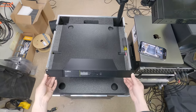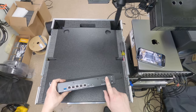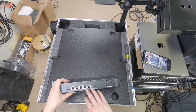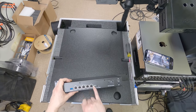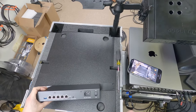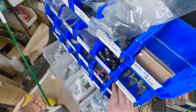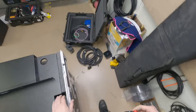The first thing I'm going to do is get the router in. One of the reasons I like and spec this router a lot is that it has an IEC inlet, which lets me use a locking IEC cable. It's also rack-mount for real — I don't have to zip-tie it to a shelf. It gives me one WAN and four LAN ports. The tricky thing about this build is the access point never came with a POE injector, so I have to have a powered switch.